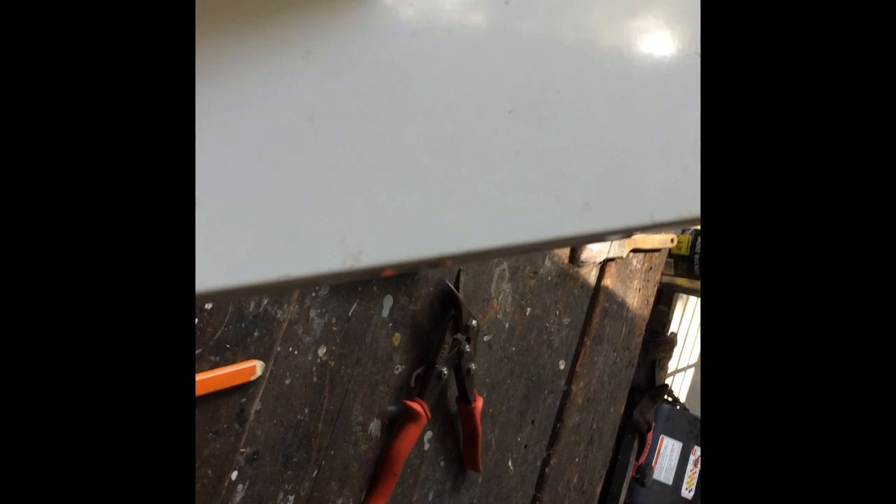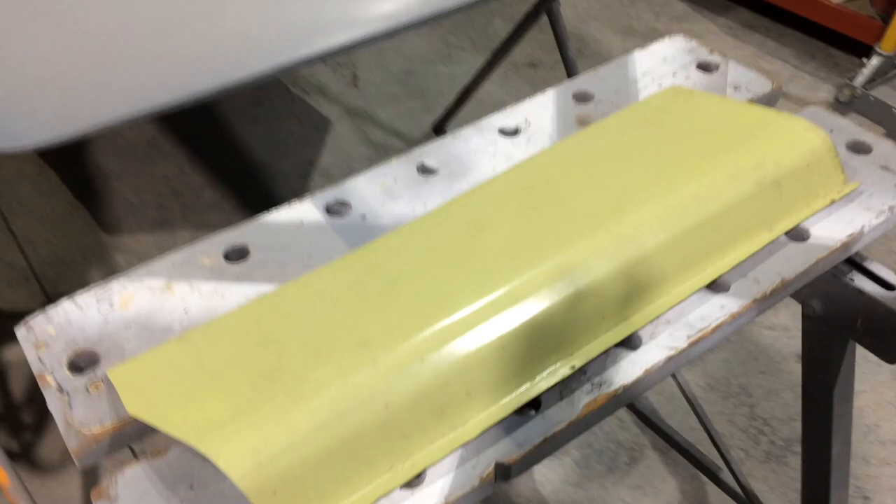There's the old bit — where it belongs. I've got this bit of steel here — it's actually off a washing machine, I think. It'll do fine. The thing I like about it is it's painted on the inside, so it'll take a long time before that ever rusts. It's already got a 90-degree edge on it, and I'm going to use that 90 as well — fold that over, and that's the makings of the patch. Put a little lip there where it joins down the bottom, and that's basically it. It's basically the bottom of the guard — got to be trimmed here, pulled into position. There's nothing to them really.